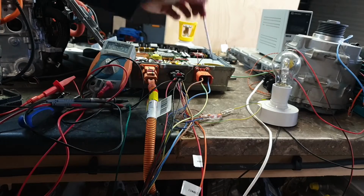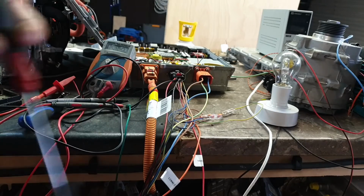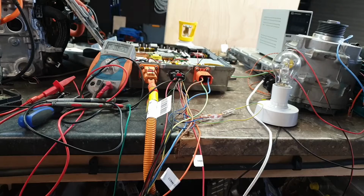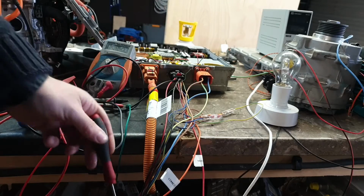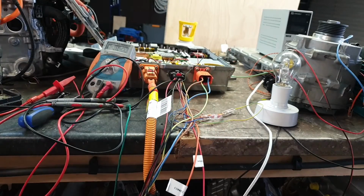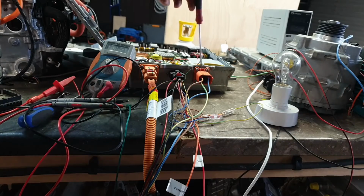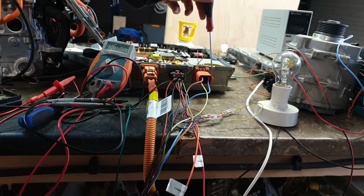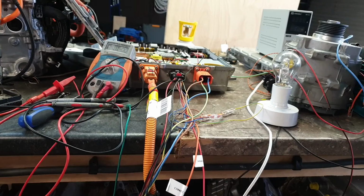And then measure the voltage that's on that connect confirm pin. We would then know what we're supposed to feed to this. Now, it's not at all unreasonable that the charger would refuse to operate if it doesn't have it. If this connect confirm is some kind of a high voltage interlock, it's not at all improbable that the charger would refuse to work at all if it thinks that, let's say for example, that either the AC plug here is not fully seated or if the BMS isn't supplying the correct high voltage interlock signal.